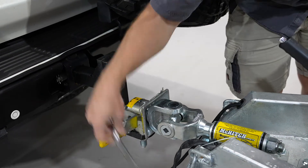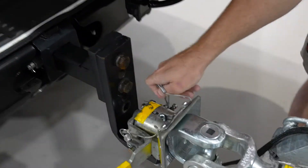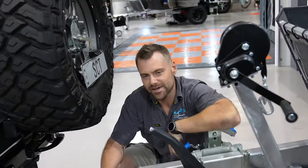Now we're on. All I'm going to do is whack the pin in and the circlip in. Obviously you're going to do your chains up — safety chains always. Lift up your jockey wheel. Otherwise, we're good to go. Couldn't be any easier.